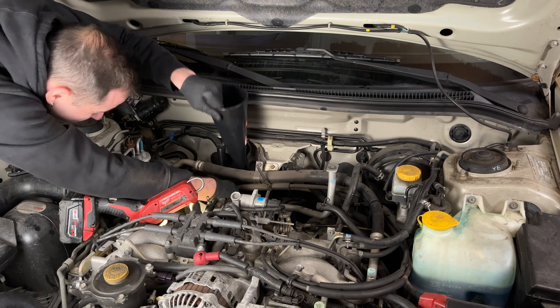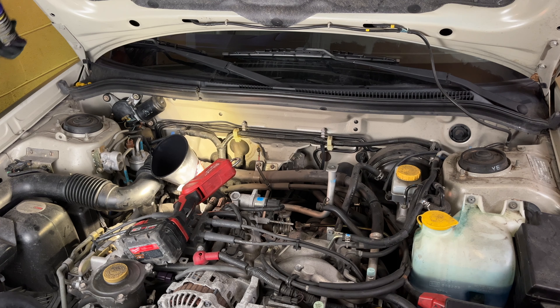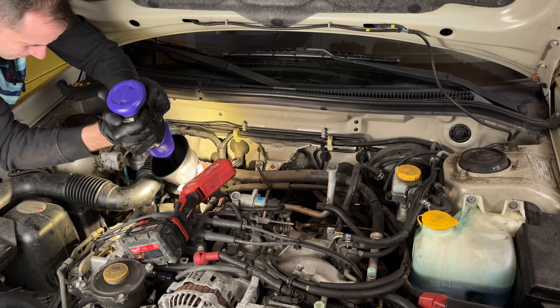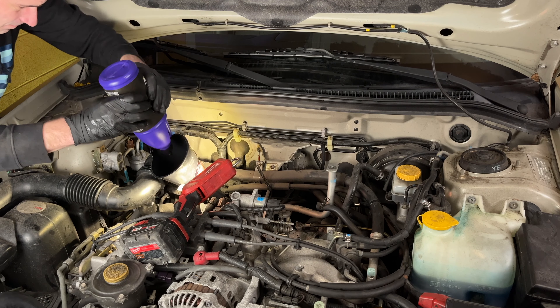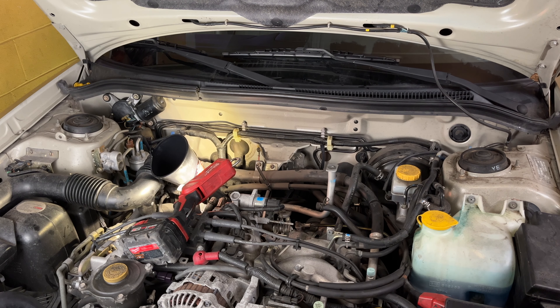I love that little light — that thing lasts forever. I left it in a ceiling at my job once and it was still on two days later on the low setting. Milwaukee makes some good stuff. Of course I went with the Royal Purple here — I like Royal Purple. Just don't use it in the rear diff of an E46 M3 — go with the actual BMW rear diff fluid because it's got more friction additive. Otherwise it'll make a weird squealing noise, but other than that I really like the Royal Purple stuff.